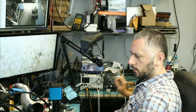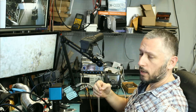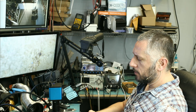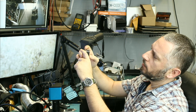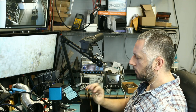Here we have an iPhone 7 Plus with a broken power button. The power button does not work. Initially when the customer came in he did not mention anything about liquid damage, but upon inspecting the phone we do see that the phone suffered liquid damage. I already took the board out and we see a red flag right here which indicates that water came in contact with this board.